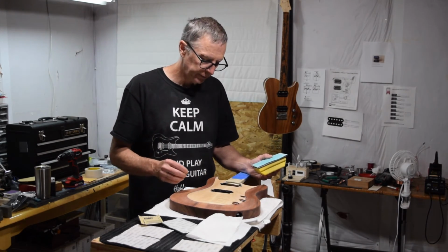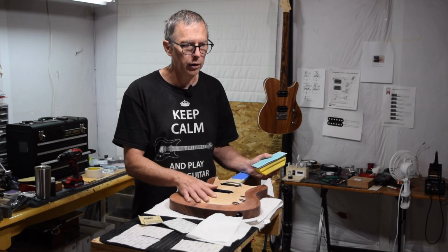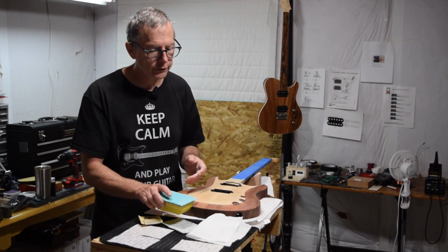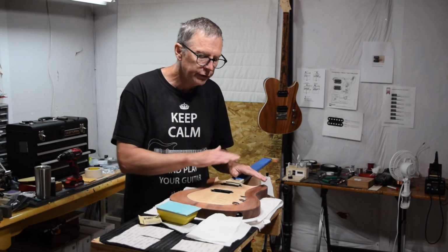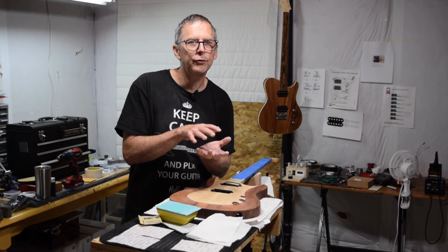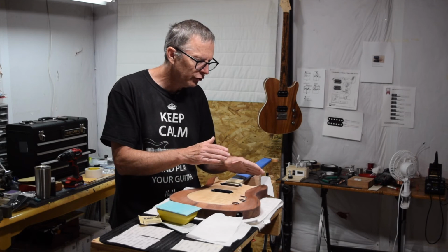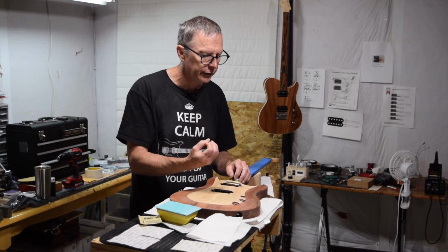Another thing you'll notice, and this is especially true if you used a water-based product like a water-based polyurethane or a water-based acrylic, I used a water-based polyurethane on this. Because each coat lays on top of the previous coat, as you're level sanding that top final coat, oftentimes you expose the underlying layers and you'll get what are known as witness lines. And I'll try to shoot a photo that will demonstrate what I'm talking about because it's hard to explain.